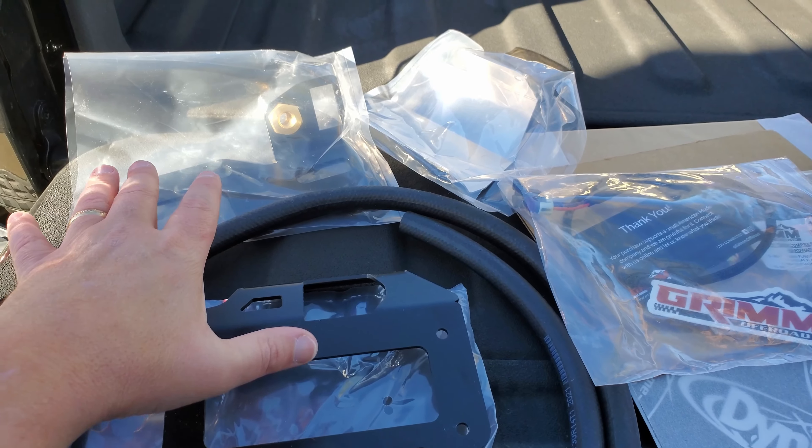Before installing everything, we'll install the air filters. They sit in here like this. Key thing is these don't have to be tight — these filters are plastic, so definitely do not overtighten them. Being very gentle to make sure I don't misthread it. Going until I get a little snug — that's good enough. I just don't want it to rattle, so I'm gripping down just a little bit. This one should be pointing this way, and the other one's going to be pointing around.